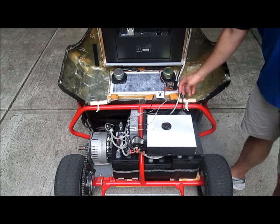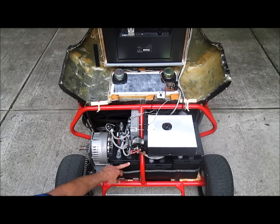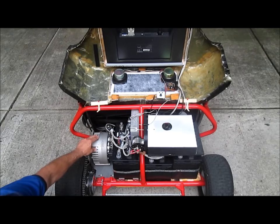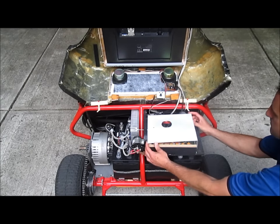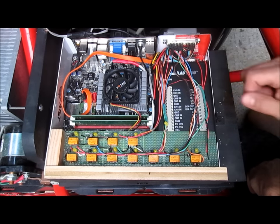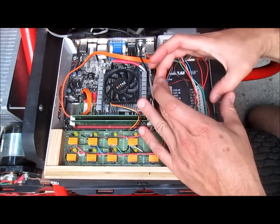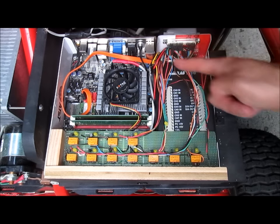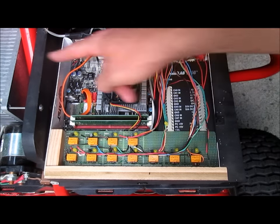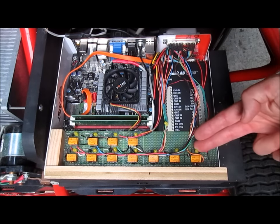Here's the back of the monitor with the video and power cables going down to the main unit. Here's the driver circuit and two speakers. The whole thing is powered by three 12-volt deep-cycle batteries. This is a Briggs & Stratton ETEC 15-horsepower electric motor with a SEVCON controller. And here's my custom control unit. Inside is a 2.6 GHz small footprint Zotac motherboard, and underneath that is a solid-state hard drive. This has two video outputs to drive both monitors and a USB connection to an interface board. The interface board talks to the motor controller, reads all the buttons on the steering wheel, turns on and off the laser cannon, reads various sensors on the cart, and controls a bank of seven relays which controls the motor speed.